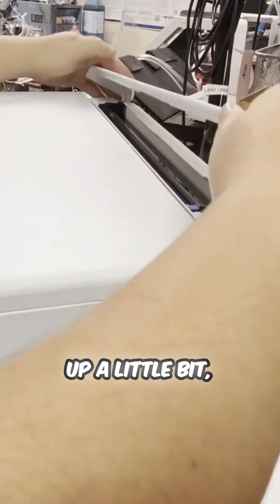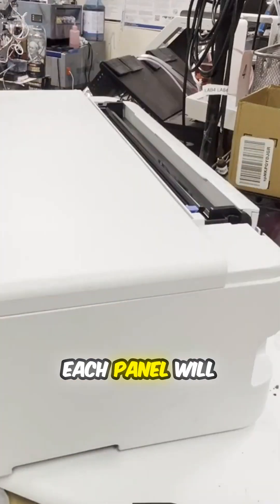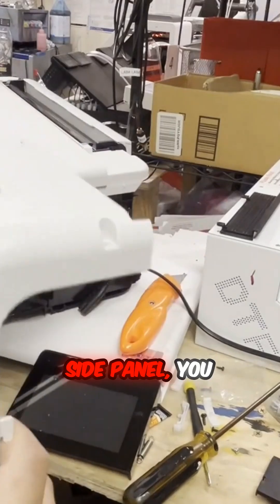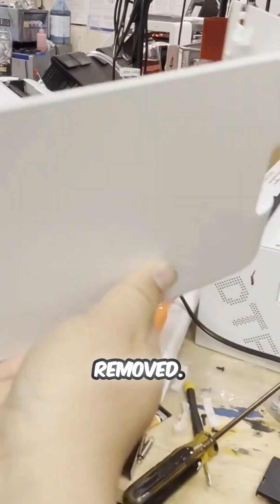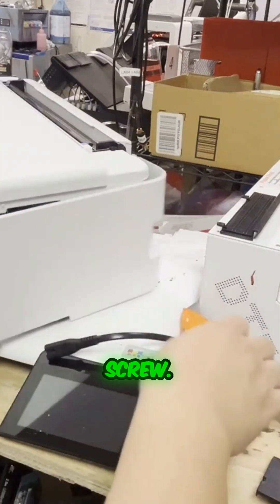You just open up a little bit, bend in the middle, and lift it up vertically. Each panel will have two screws. For the right side panel, you can see there's a screw underneath the power socket, and there's a top screw that we just removed, and then underneath the ink tank, there's another screw.